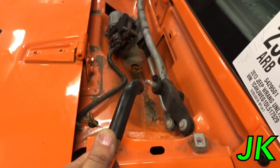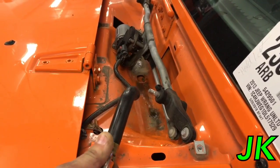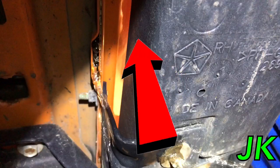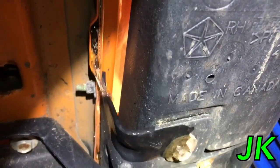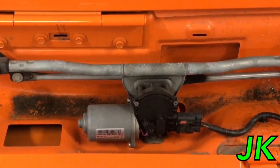Let's go ahead and put some water in it and see where it comes out. Where this water comes out is actually on the body seam — you can see the right side running board or step bar, and to the left of that is the body seam with that little opening — that's where the water comes out. There are several of those holes where water drains out, and if that gets clogged up with small debris, it fills up and goes back into your AC system. It can also get clogged right here in that oval area and back up into your HVAC system.